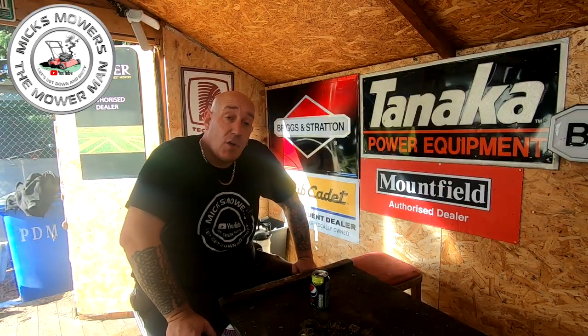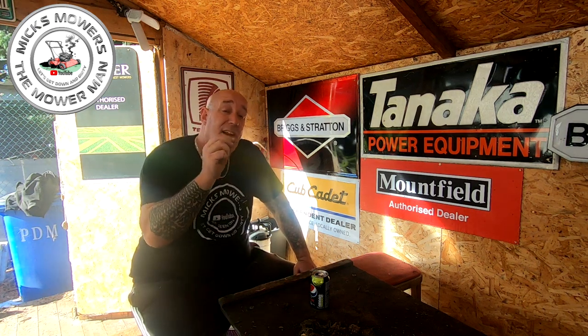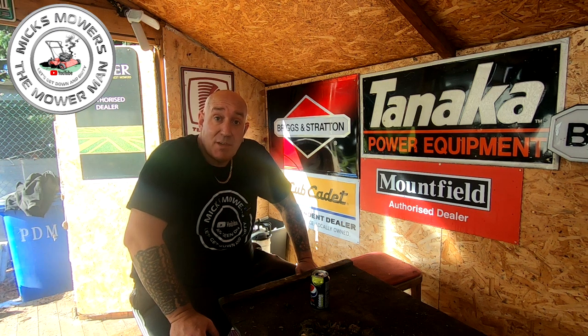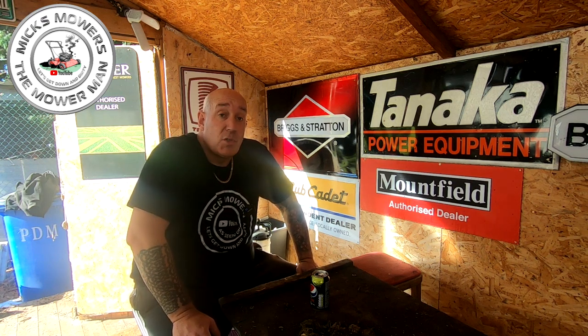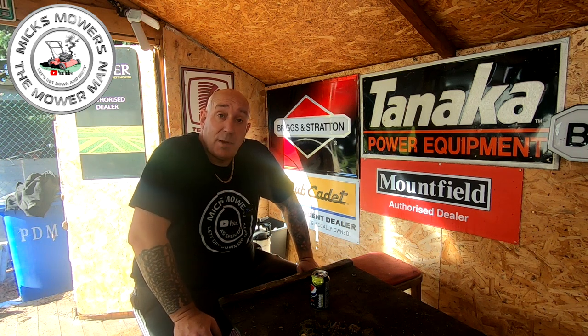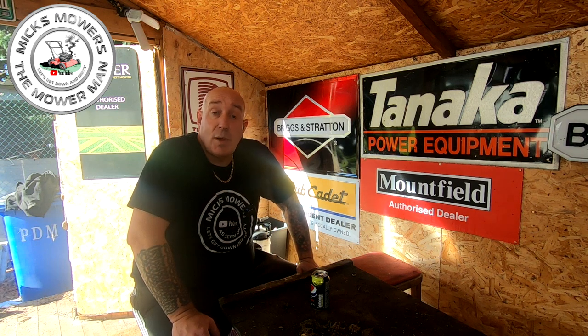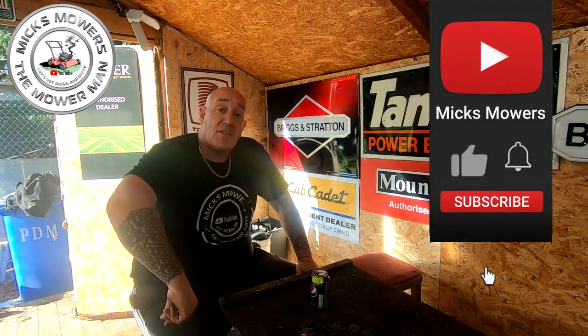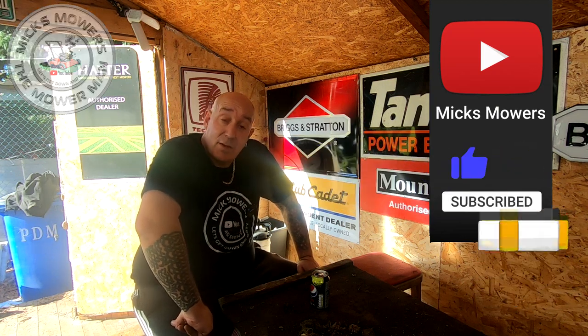So there you have it — a Hayter 48 all up and running. I've got to sort the micro switch out. What's happening is, as you pull in the dead man's handle, it's just not quite clearing it. I've just got to adjust the cable, or maybe just adjust the micro switch a bit more, and it will then start first time every time. And that might be why the person originally threw it away — because the machine was failing to start, because the micro switch is just slightly out of adjustment. One simple tweak on the cable or a bit of bending on the micro switch will clear all those problems. If you want to see a little video on how to do that, leave it in the comment section and I'll do a little video on it. Hayter 48, 41, 56 side drive — how to install the drive cable and how to adjust it properly — and before long you'll be cutting nice stripes as you should. Hit your subscribe button, whack the bell, set notifications to all, and I look forward to seeing you very, very soon. Until then, take it easy — love you guys, bye bye.